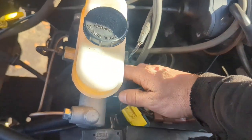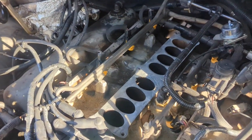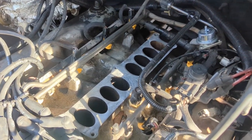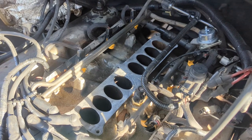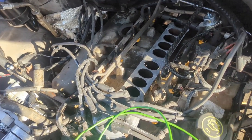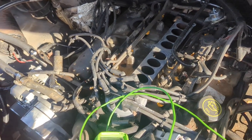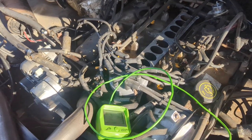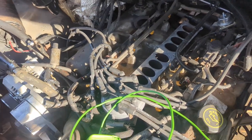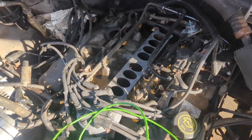If I jump my fuel pump relay it sounds like a toilet bowl flushing. Pretty sure one of our freshly remanufactured fuel injectors is stuck wide open. So I'm going to take a look with the scope to figure out which one it is, and then we're going to pull the rail, take all the new fuel injectors back out, and put all the old ones back in.